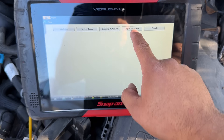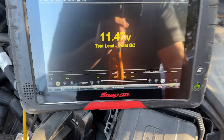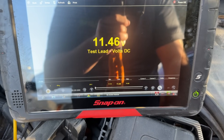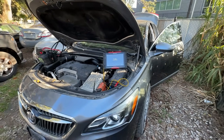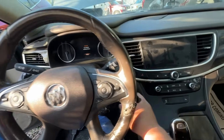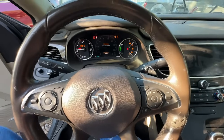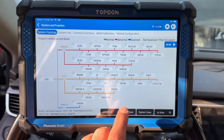Instead of the graphing meter, I'm switching to a digital multimeter for a big number on screen. With the engine running, battery voltage is only 11.4 volts — the charging system is not charging at all. We're solely running off the 12-volt battery in the trunk, and the longer we keep it running, the more it'll drain. I'm going to cut the engine off and turn the ignition on by holding the button for 10 seconds. The instrument cluster came on. Now I'm going to run another full scan with the scan tool.